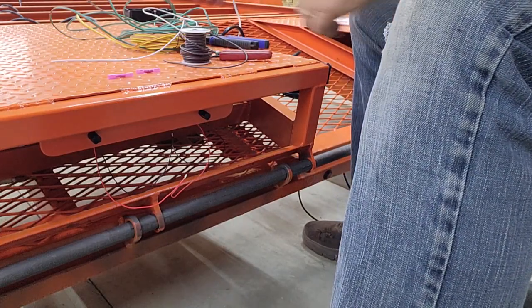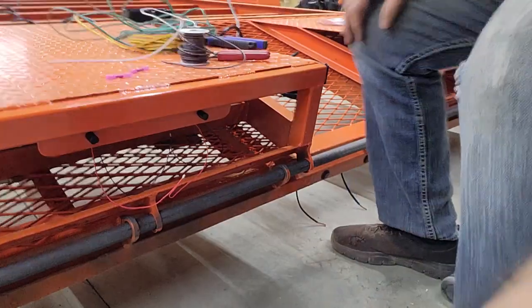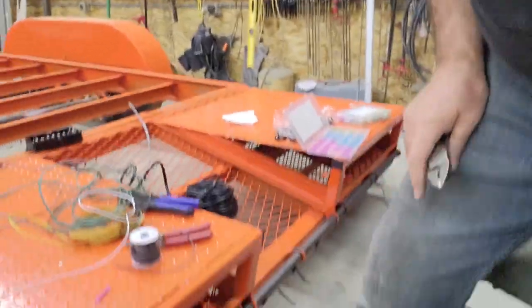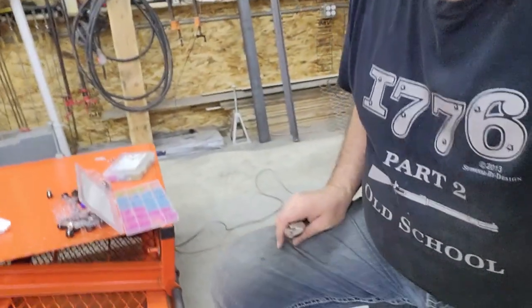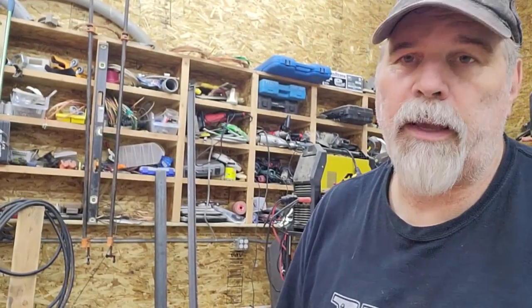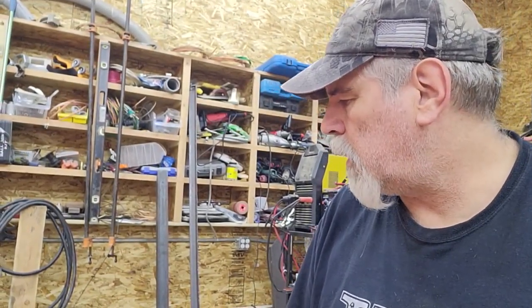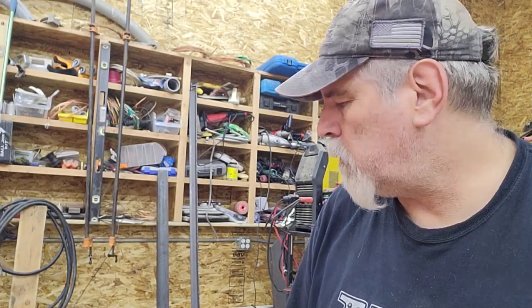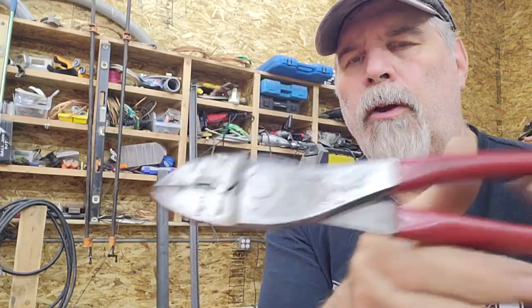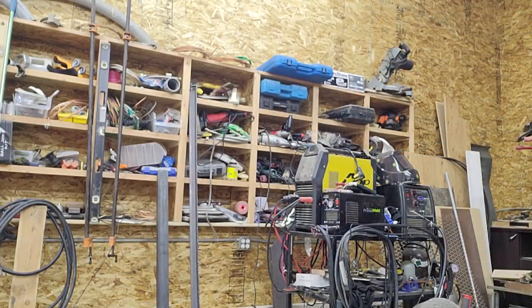So if you're using a non-insulated, let me grab my other set of crimping pliers. If you want a really super clean install and the best crimp you can get, though there's nothing wrong with insulated connectors, I prefer in some cases to use non-insulated butt splice barrels, crimp those, and then put a piece of dedicated heat shrink over them, because I believe you can get a better crimp if you use the style of crimpers that look like this. They have a little nubbin right there. So when you crimp the butt connector, actually, I'll use the dry erase board, I can draw it for you.